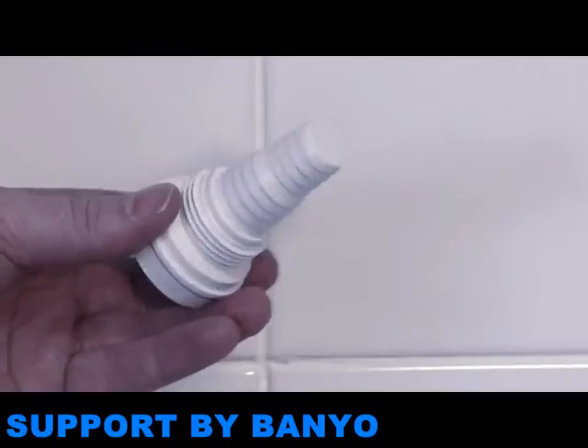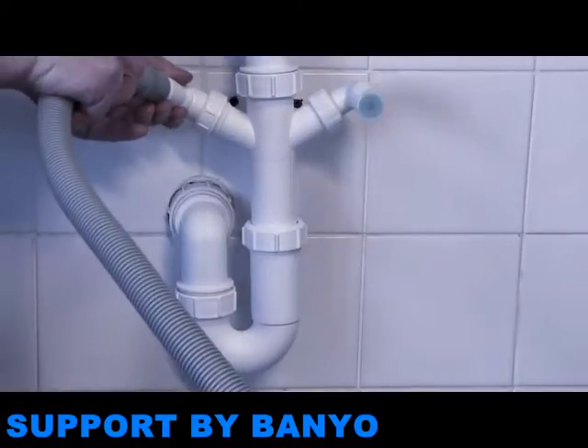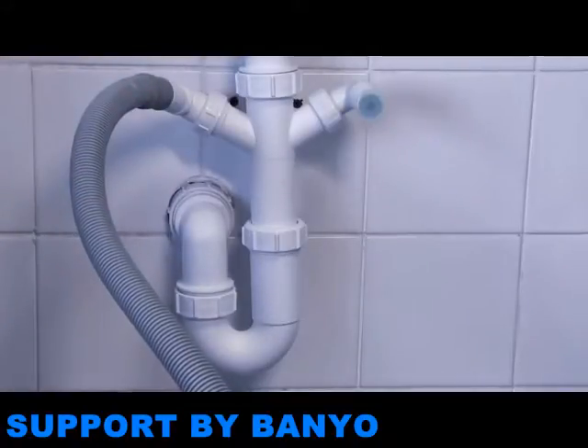With some other traps, you will need to saw off the cap. Check there are no kinks in the pipe, and connect the wastewater pipe to the trap securely. With some dishwashers, you'll need to use the additional adapter and clips provided to attach the pipe.